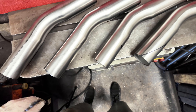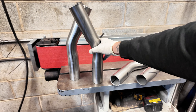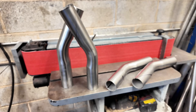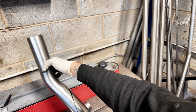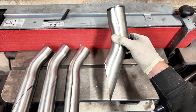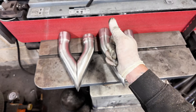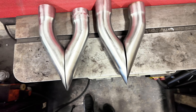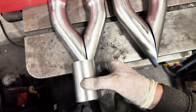Today's job is an Audi A5, 3 litre TDI. It's already had some DPF magic - not by me. I'm told it's been super cleaned, so the DPF is gutted potentially. Our job today is we are doing a set of backbox deletes. As you can see it has already had a diffuser installed. Our job is going to be basically convert it to a quad exit on the back so it looks like an Audi S5. The 3 litres only have the back silencers, there are no mid silencers, so with the DPF out and the back boxes off this will essentially be a straight pipe. They do sound pretty sick, so we'll do a little before and see what it sounds like, then once we've done the job we'll do the after. We'll probably even take it out on the road so if you are thinking of straight piping your 3 litre TDI, you can have an insight as to what it's actually like - does it drone, is it ASBO and all that jazz.